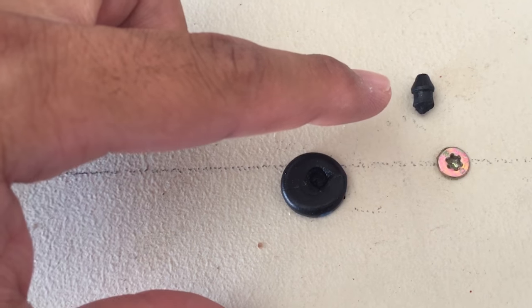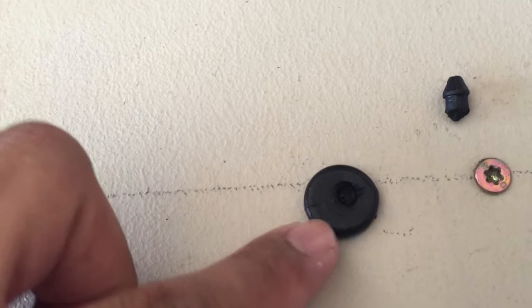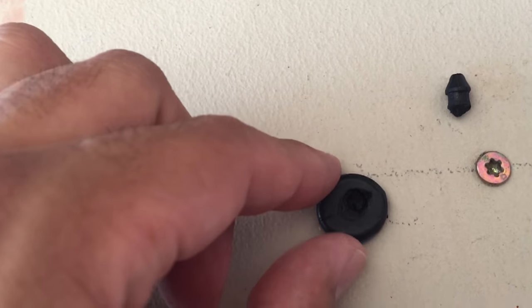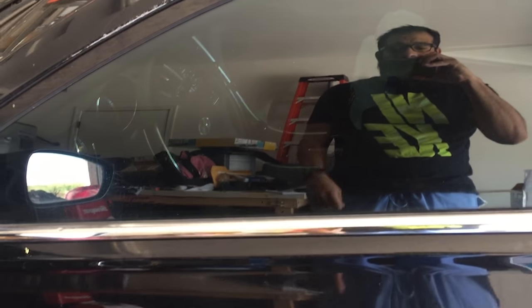This is the padding I'm talking about. It was on the floorboard when I first looked at it. As you can see, there's an indentation on this rubber pad, so that's letting the switch fully extend out and not pushing it into the switch. It takes two seconds to replace — it just pops right off and you put the new one in, and that fixes your problem.